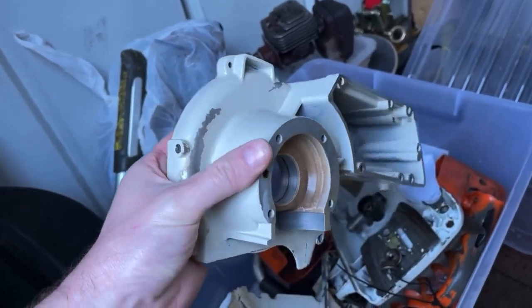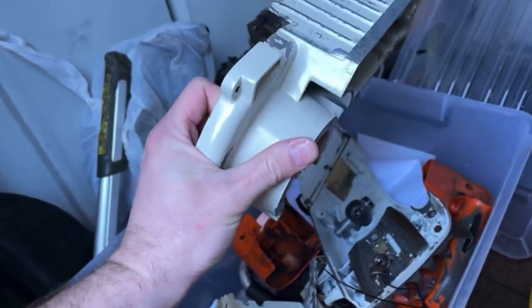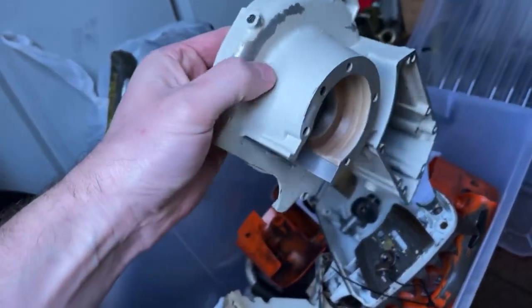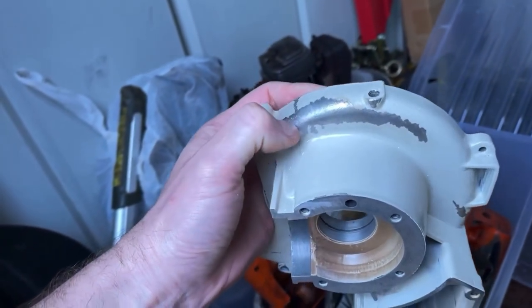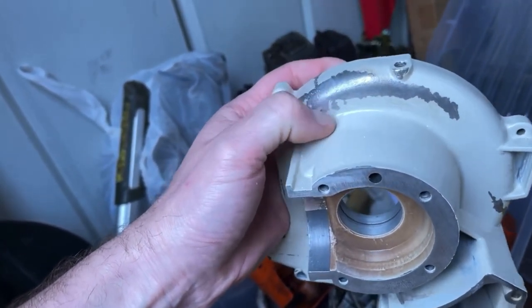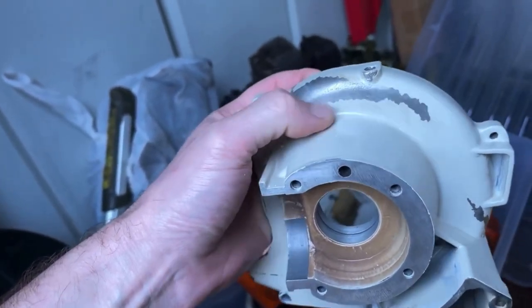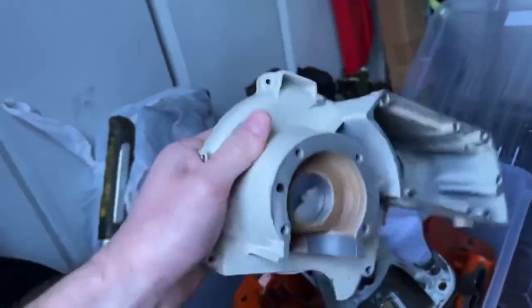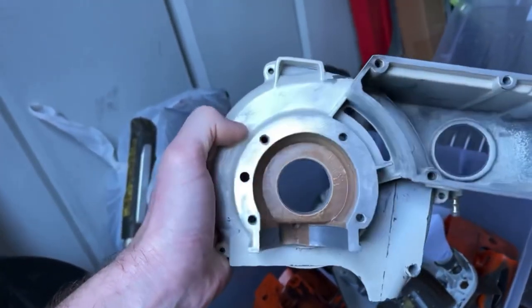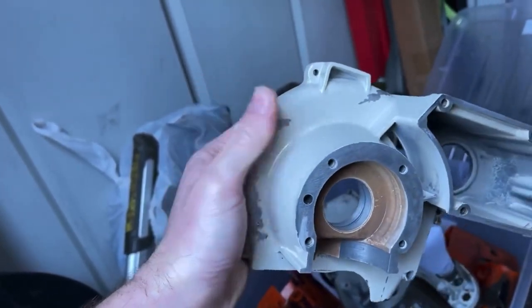And that was fine. I taped it all off. I got a paint match. As you can see, this has all been repainted. I did the paint job on it. However, I'd noticed when I went to test the paint, it peels off. And I'd done the preparation all correctly. Everything's been really well keyed in, sanded, very well cleaned with a thinner, followed by acetone. A number of layers of acetone, it still didn't stick.